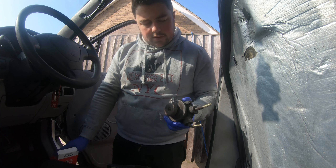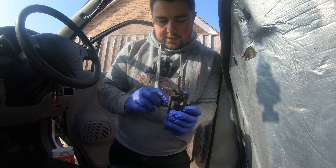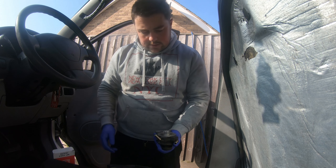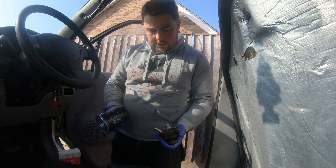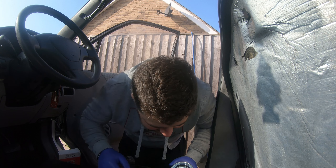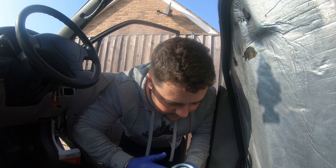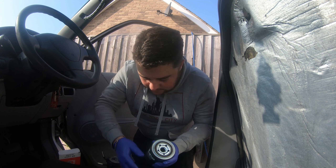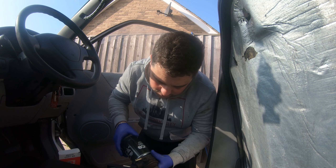I think I might put an extension on — so much rust in my face. Yeah, I'm going to need an extension. As I climb a million miles back out from under the Bongo — that's better. I've done it up tight-ish but it's still going to leak from this hole. Once my mate's welded this and this, I'll check it's properly tightened down and sealed up with that little gasket in. Hopefully no more exhaust blow.